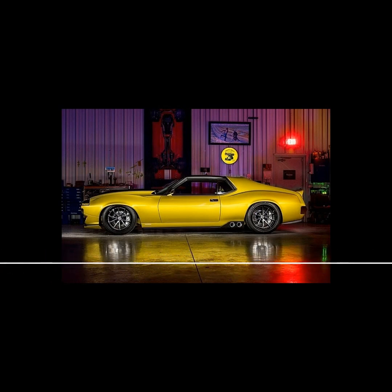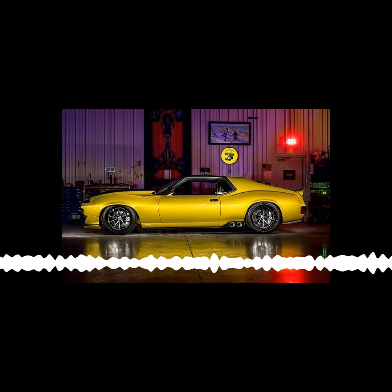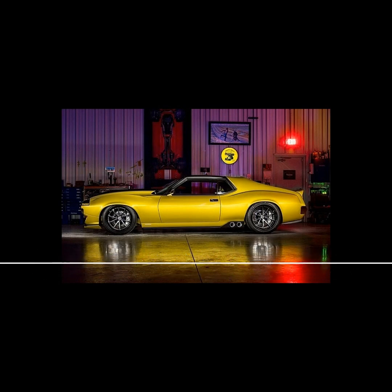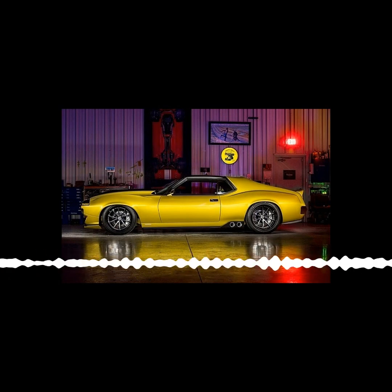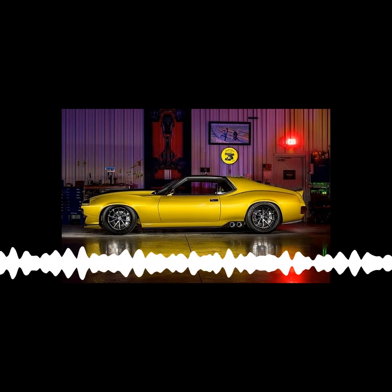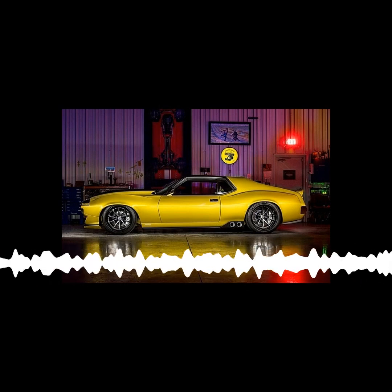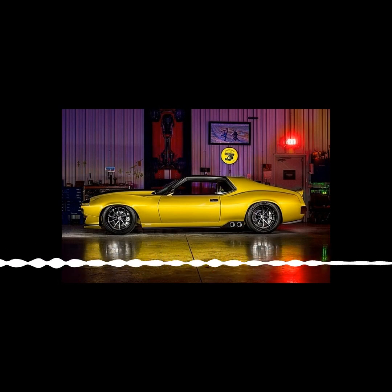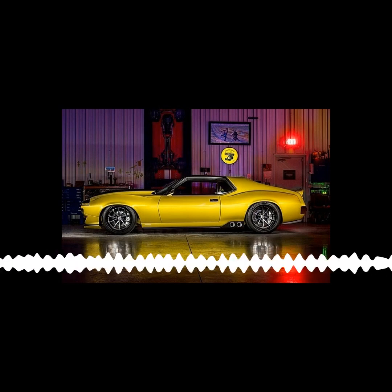And the key is we use, it's more of like a polyester resin, it's not auto body clear right away, because that clear is so porous. I used to do it with automotive clear, but you literally have to brush it on to fill the pinholes. With this Duratec product that I use that has UV protection, I'll start with that, and with the acetone in it or MEK in it, either one, it will fill the pinholes much better.